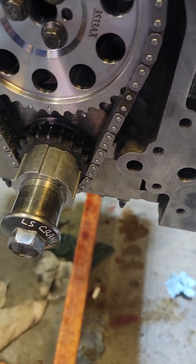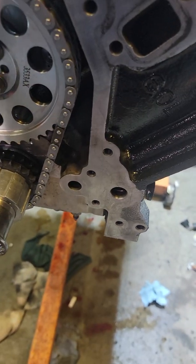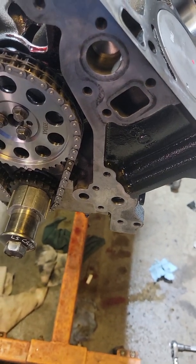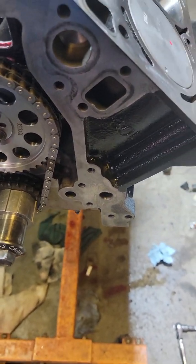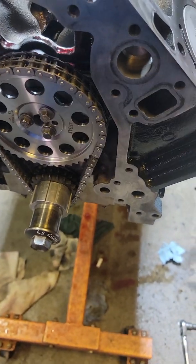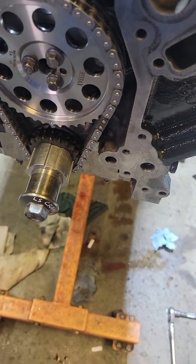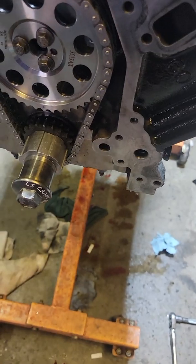The oil gets into the pump from the pickup tube, and that's where having a good seal is important because that side is under suction. Because this side is under pressure, even if it has a little bit of a leak, the spring just won't disengage — it won't have the pressure in the pump to push the spring — so the oil pressure is just going to build up higher until it gets high enough to release the spring. As long as this doesn't have a massive hole in it you're fine, and even if it does, if it's a high-volume pump you're probably fine anyway. That's why putting RTV on it is just not important. Now if this were the other way and it was actually sucking oil in, I would say yes, it would be very important, but being that this is the high-pressure side, it does not matter.